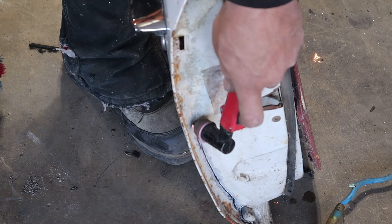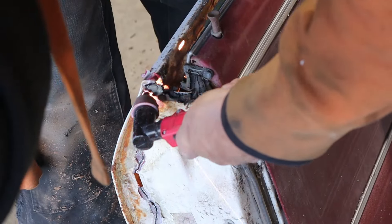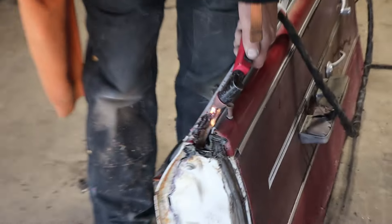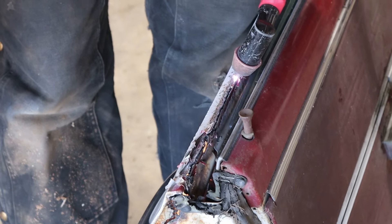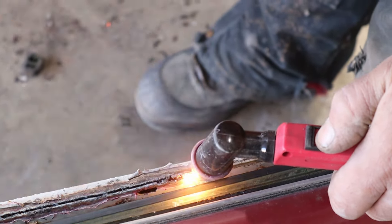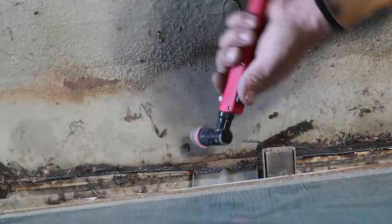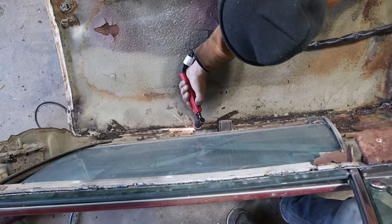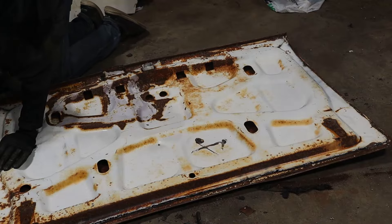A big part of gutting out these body panels is getting rid of the interior or excess material. It'll be way easier to straighten if it ever gets bent, and I can get rid of all that ugly red inside and just make it look much better for a race car. Not only that, but that interior weighs a lot. We have an extra couple hundred pounds of lead on the back just to make weight, and the inside of the doors is not where we want that weight — placement is huge in these cars.